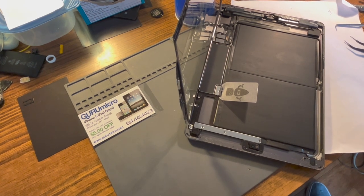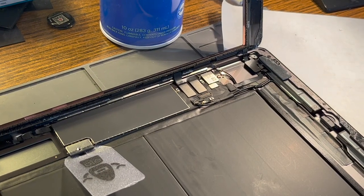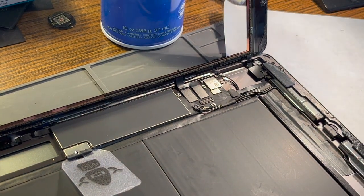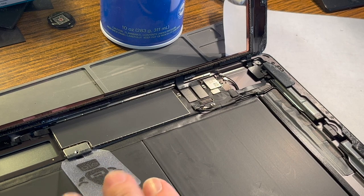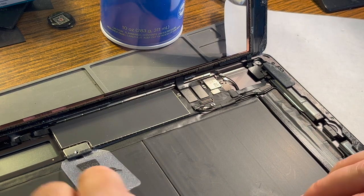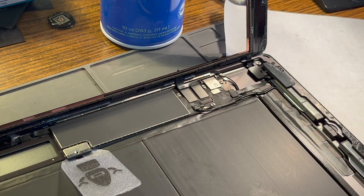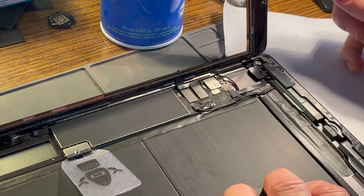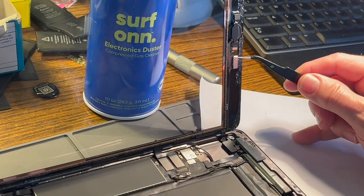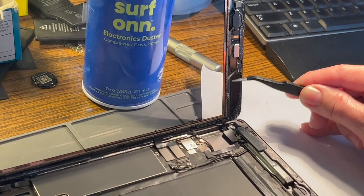I'm going to put this screen in a safe place and be right back. So next thing we need to do is get the digitizer — which is the glass — removed. Our battery block stays; that won't come out until I reconnect and I'm ready to do the final testing. So your home button cable — I was talking about earlier — I'm going to tip this just a bit. This is glued to the back of the glass, so you can't just yank this off. It's kind of a slow process to get this out. There's a little rubber piece on the 7th, 8th, and 9th gen. I'm just using my spudger to lift that off.